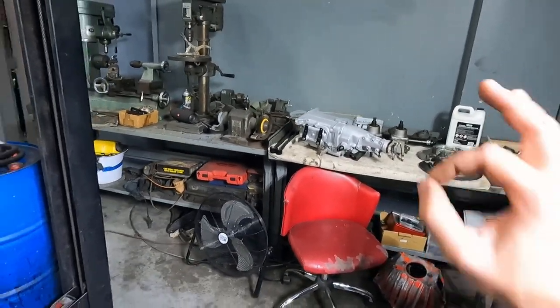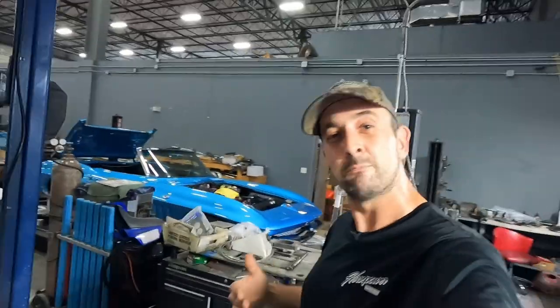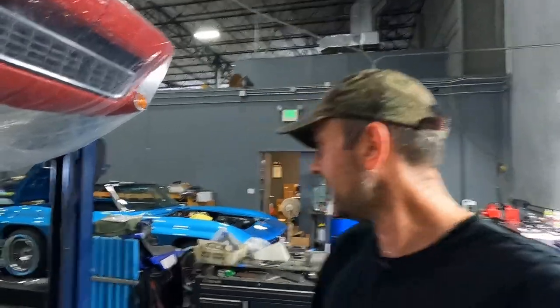We're in the clear now because we circumvented it before it happened. So if you guys have a '66 or '67 Corvette with a four-speed M20, I'm talking to you — you might want to make sure you don't have that anti-backlash plate in there. I'm also going to drop a video in the description from a guy that specializes in transmissions who did a really in-depth video that explains this a little bit further than I'm going to today.